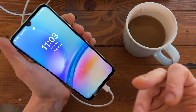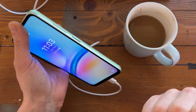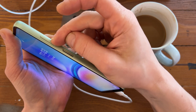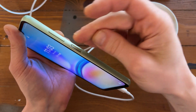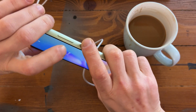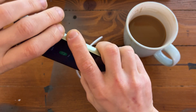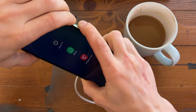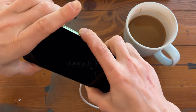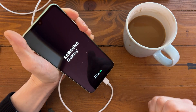Phone is plugged. Now we need to reset. First we need to hard reset it and boot to the bootloader. To do that for hard reset, it's the power button and volume down button, and as soon as it restarts, switch to the volume up button. It's power button and volume down button and it shows this screen — it may not show. However, hold it. Next it's power button and volume up to boot to the bootloader.